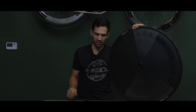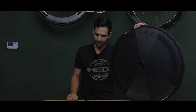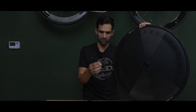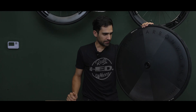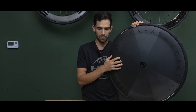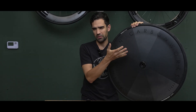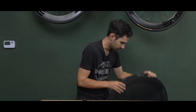In the previous 12 months I think I have already made quite a few videos on the issues that these wheels are plagued by, and the solutions we have implemented to fix them — mainly the tri-spoke front axle and the Tactic rear axle, which is suitable for all wheels with Tactic hubs. This has been the test wheel provided by our customer to try all these in practice and see if it works long term. Very early on there has been another problem outside of the bearing preload problem that popped up with this very wheel and lots of others, as I gathered from interactions with other Princeton wheel users.